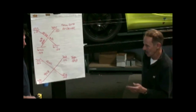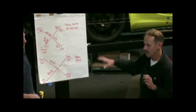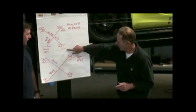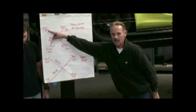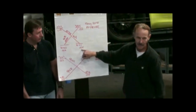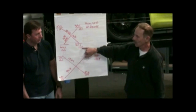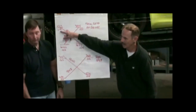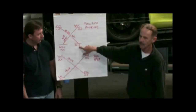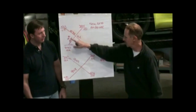You have to measure ride height and corner balance every time — that's the hard thing. If you just do corner balance alone, you can't get it right. Because your corner balance move affects ride height: last night when we tweaked this car, we ended up raising the left front because the ride height was low on one side and high on the other. We could have raised it on the other side and come up with the same corner balance numbers, but it would have raised the high side more and dropped the low side more. Because we looked at ride height as well, we went with the correct side.